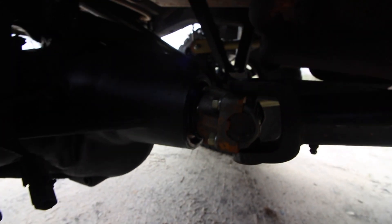With the spacers pushing the wheels out a little bit I get full lock, and since these wheels don't have a lot of backspacing the steering on this thing is like drift-spec — no scrubbing, it drives amazing. The Adams driveshafts are front and rear. The front one was the same one I had from my stock Dana 30, and I did a 1310 yoke off the back of the Dana 44. 1310s are plenty for this — it's almost better to blow a U-joint in the driveshaft than shear gears.